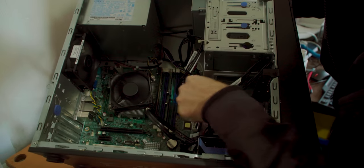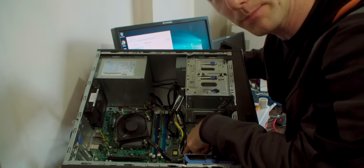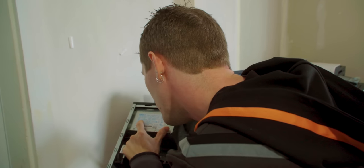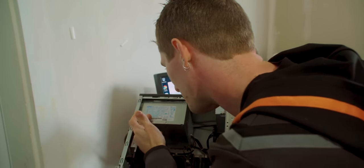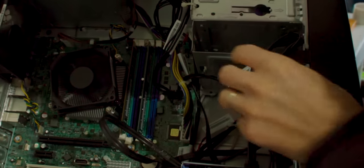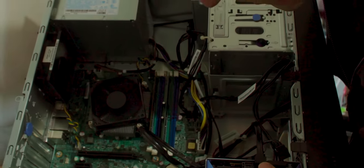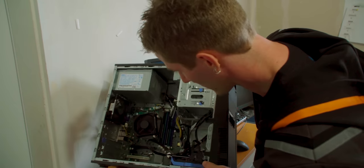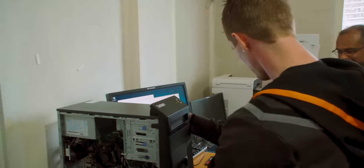What I was expecting right here is this very unfortunate 14-pin power supply connector. I think we have a workaround — we found a pinout map online. This does appear to be a standard ATX power supply. If this'll get us 270 watts... it's super weird. It's got SATA connectors that come off the board too. There are only two connectors coming out of this power supply.